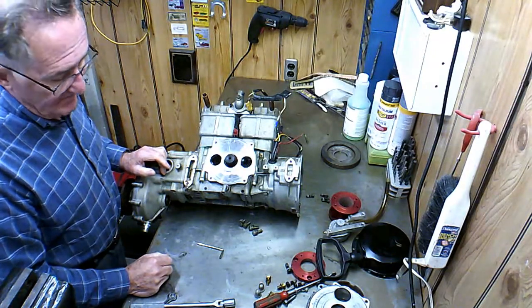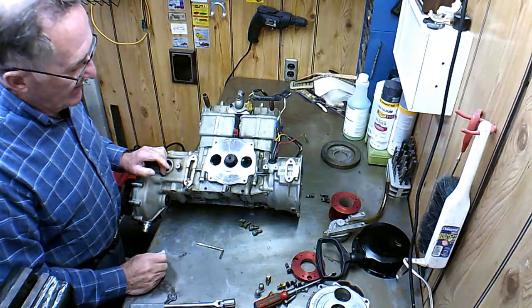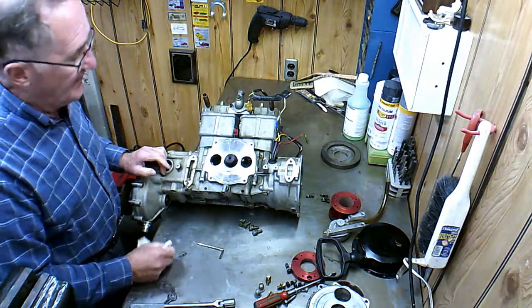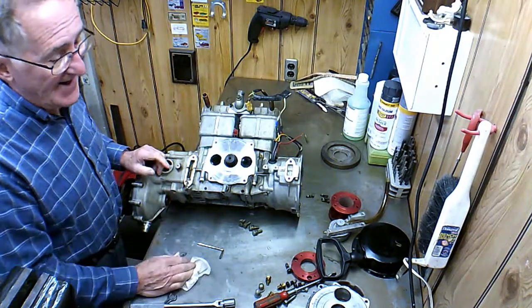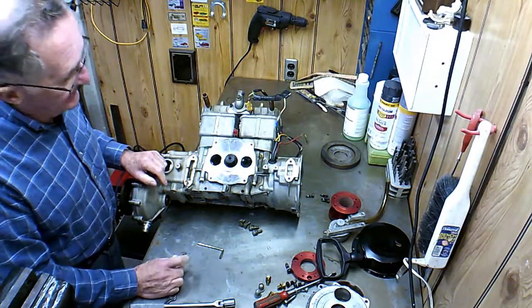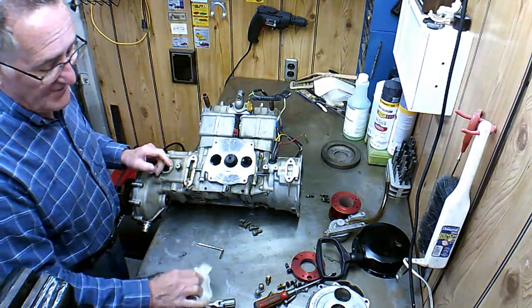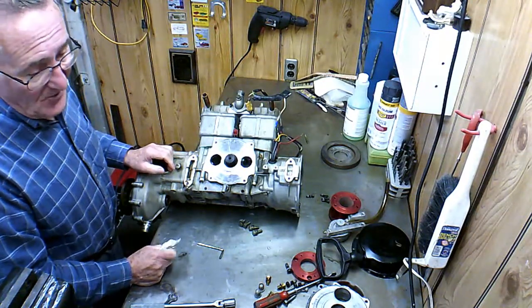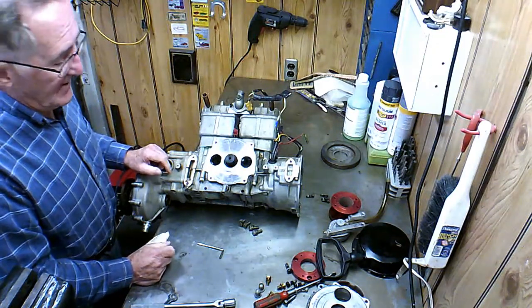Well, after carefully calibrating and keeping track of it and really checking it close, we also took apart the oil system, took all the oil lines off. He bought a new oil pump, new injector lines, new everything except for the tank, I think, was the only thing he didn't replace. We couldn't find anything wrong with it. I'd run the oil pump on the drill press downstairs, and I see how it works and everything. There really isn't anything to go wrong with it. So in my opinion, it never pumped in the right amount of oil to start with. I can't understand how it ever could have worked right.